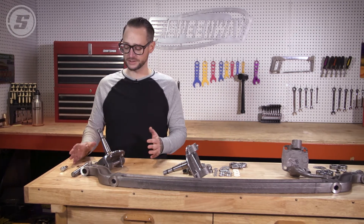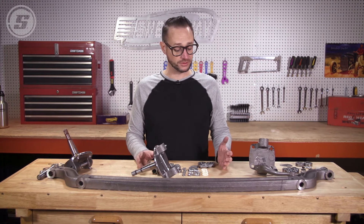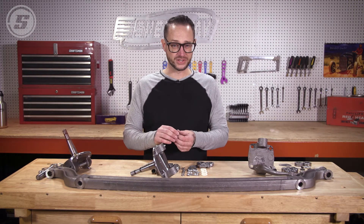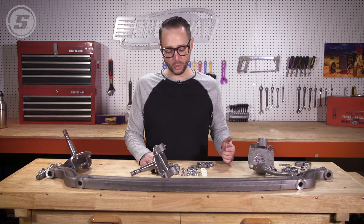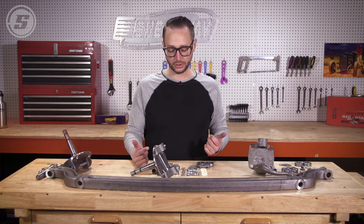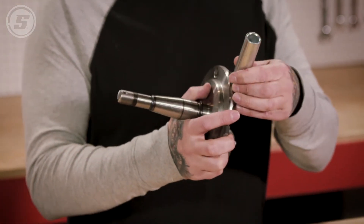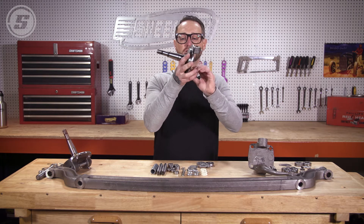That's the standard kingpin set — pretty simple. Where the difficult part comes in is when we step to the 37 to 41 deluxe kingpins. They do require a lot more work, but they offer some value — they're going to last a lot longer. The technology with standard kingpins is obviously old and they've stepped it up here. We've got little needle bearings that help the kingpin ride, they wear a lot better, and the way you grease them is going to be a lot better for a long-lasting lifetime for your front axle setup.